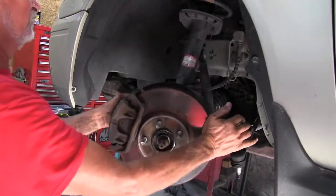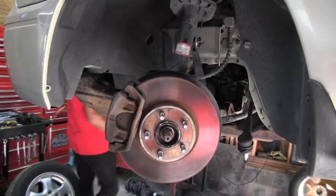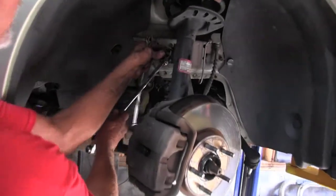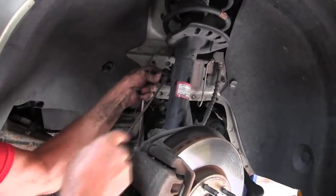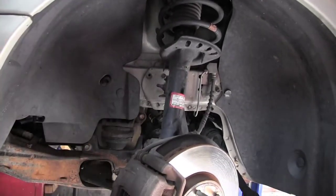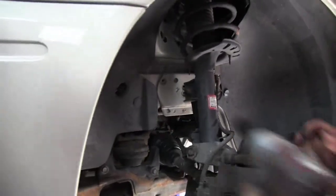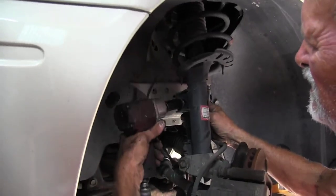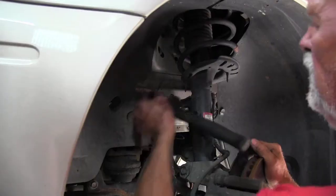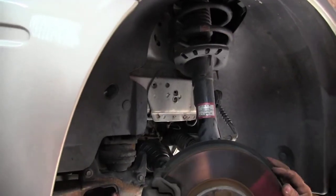Okay, now you turn this a little bit. We've got to have an 18mm and an 8mm. Get these two wrenches. Put one on the inside of the... Oh, that one's going to fit tight. Let me break it loose if I can. Socket first. Come right off. We got lucky, the nut came right off of that stabilizer bar right there. Doesn't want to pull off just yet, so that'll be alright.